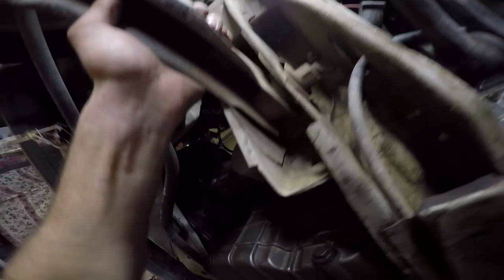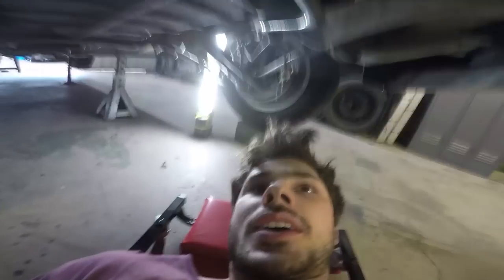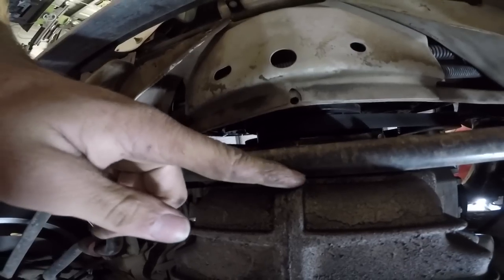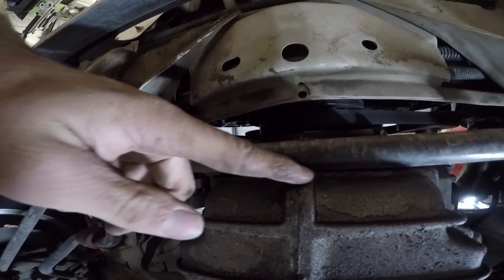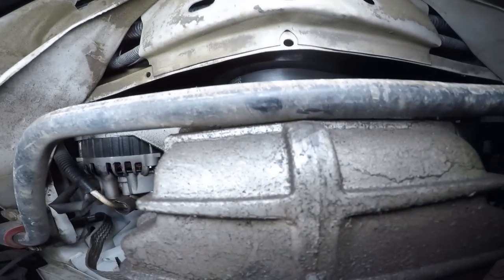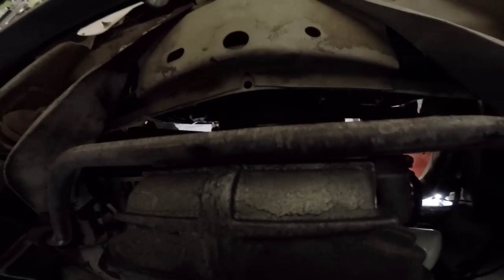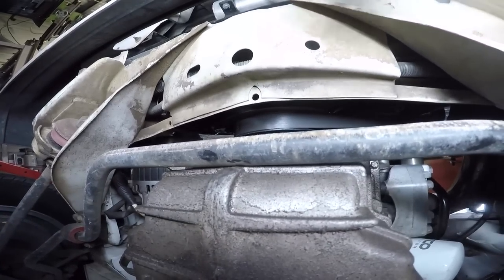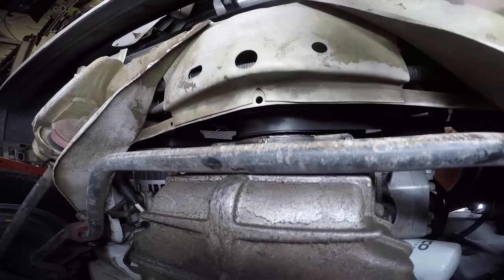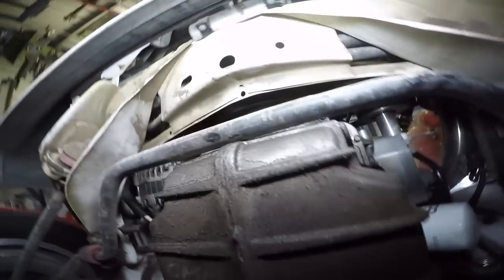And that's pretty happy. Your sway bar, there's two things you can do with the sway bar. You can get a custom one made, because your issue is going to be here, hitting on the sump with the Rod Shop mounts. You can already see, with the car jacked up off the ground, I'm pretty much touching the sump. So it will hit the sump. But what you can do is get a custom sway bar made up that has a notch here, which will clear that sump. Or to make this issue a little bit better, because to be honest, it's not that big of a deal.